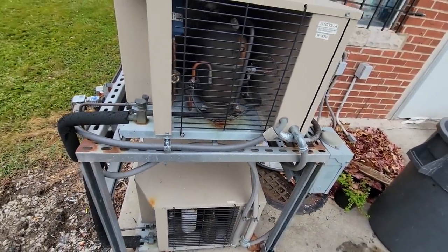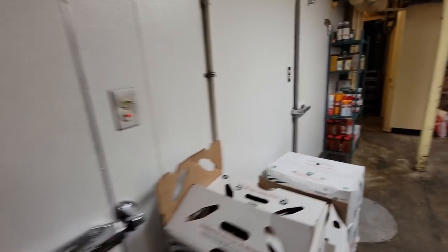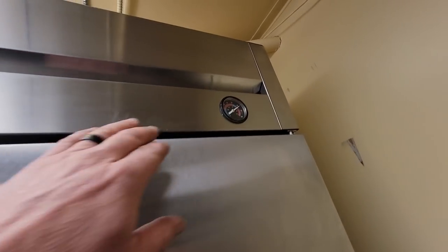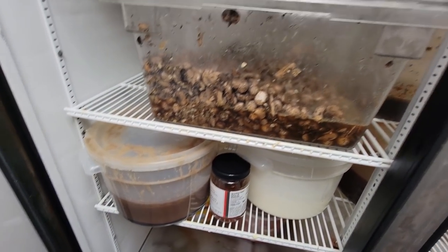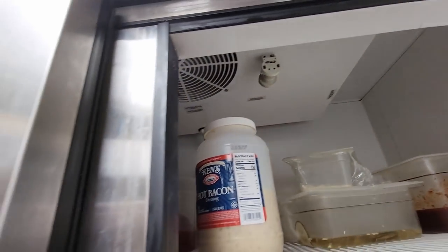Let's go inside and see what we've got going on, see if it's anything beyond just that. There's the freezer. Here's the cooler — it ain't quite as warm as they said. It's 44, which is still too warm. They said this thing over here is not working right. What's important is your product temperature — can't trust those junk thermometers. We'll take a product temp. Stuff up there is 39, 38 after adjusting that thermometer and the thermostat up there.